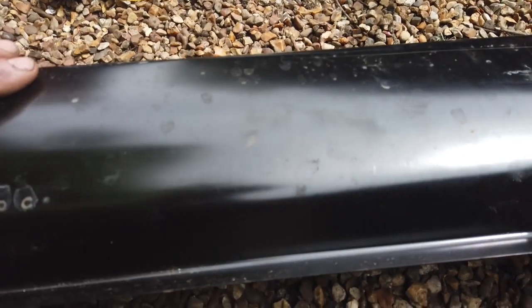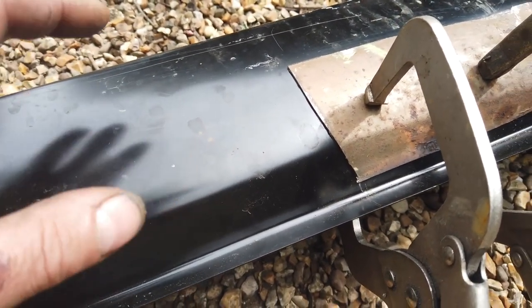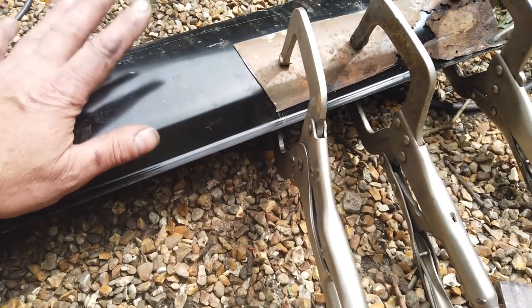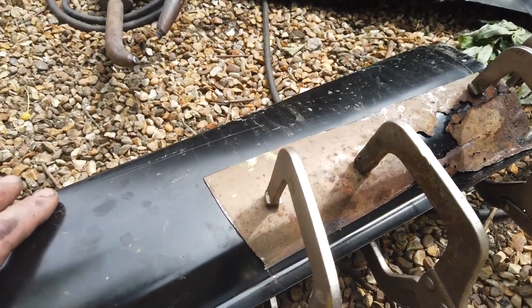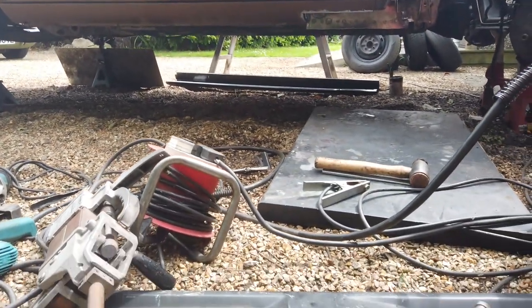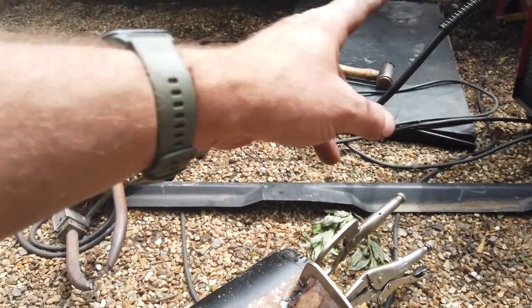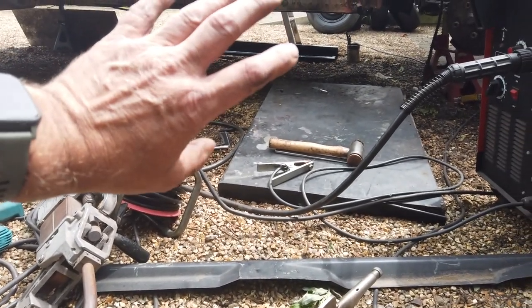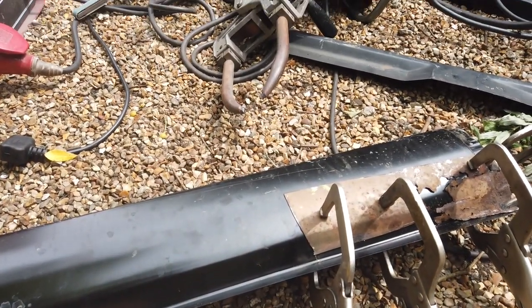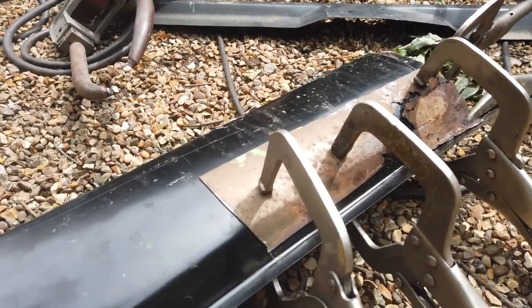I know it's not quite the right thing to do but I'll keep this piece because I need the back end. Really the middle section - probably two thirds - won't be used, but someone could make use of it. If it was new old-stock Ford I wouldn't do this - it's a copy one and I got it at a reasonable price. The sill in the rest of the car is fine - there's no point making work for yourself. I've got a nice row of spot welds along it - good penetration. I'm going to spray some weld-through on it so it doesn't burn as bad, as a template.